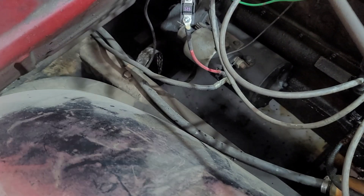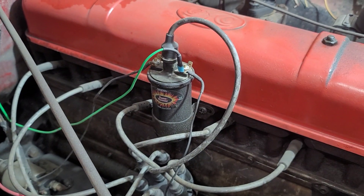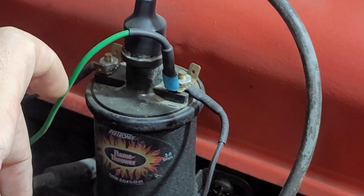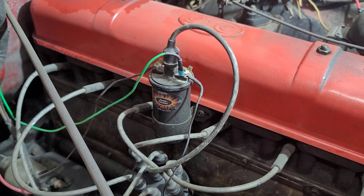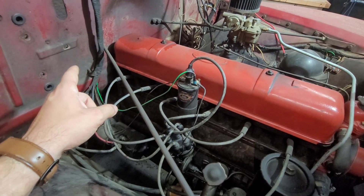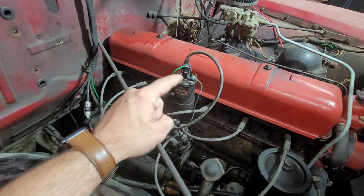And again, when I talked about battery cables - you see what I mean. I still have the black one because mine was a 6-volt positive ground system. Now, when we're on this side of the truck, we need to switch out to a 12-volt coil. I got an internally resisted 12-volt coil, and that means it has 3 ohms of resistance. All that does is take the 12 volts coming in, turn it into about 9 volts coming out before it hits the points, and it keeps the stock look. What you can also do is get a regular 12-volt coil and add a ballast resistor - most people put it on the firewall - and that does the same exact thing. I'll put a link to this coil in the description, and I do recommend it because you can keep the stock look, and honestly I think it's cheaper than buying a coil and a ballast resistor separately.